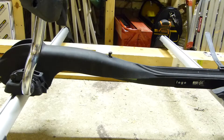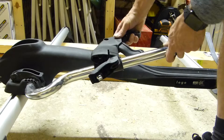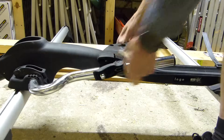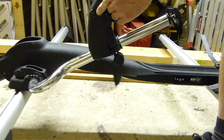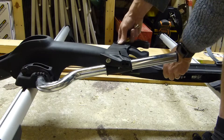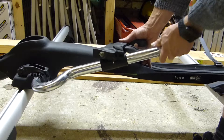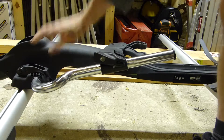When you don't have a bike on the carrier, you can still lock it and stop it being stolen. That works using this little knobble down here with a cutout in it. When there's no bike, you push the arm down and line up the little hole in the clamp with that knobble. When positioned over the top and you close the jaws, a little piece pushes across the hole and fits into the cutout in the knobble. Tightening the clamp locks it onto the knobble, and turning the key prevents it from being undone. That also prevents the clamp and arm being lifted, and of course the clamp on the other side holding it to the bars also can't be raised.